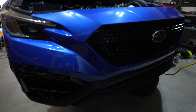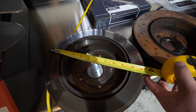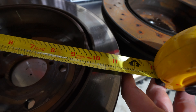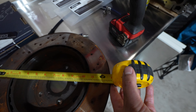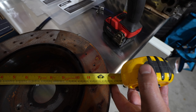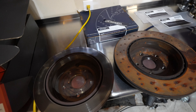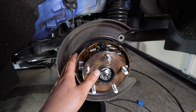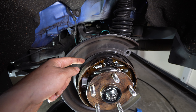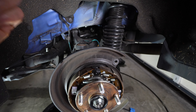Looking at the stock rotor, you're just over 11 inches wide, like 11 and a third probably, and the STI rotor is 12 and three quarters - so it's like an inch and a half bigger. The dust shield is too small, and what I did on the other side is just use a flat head. You basically have all these little welds around and if you use a flat head and just pry it down and hit it with a hammer...